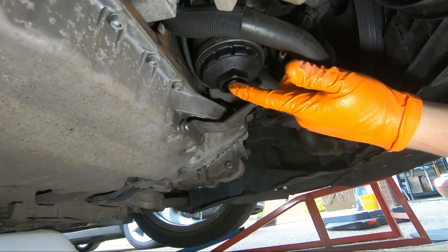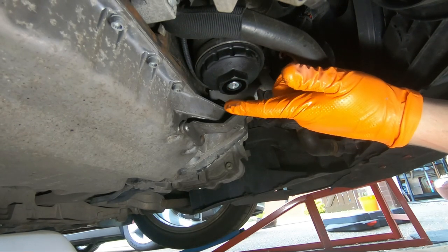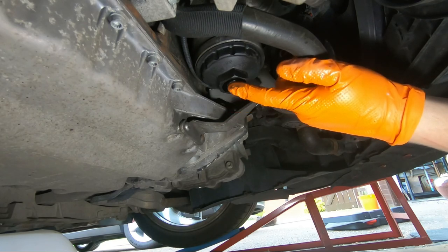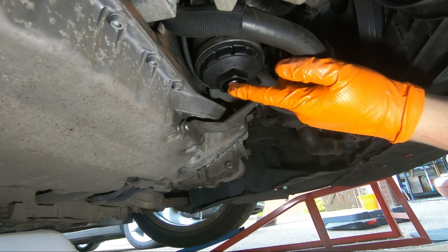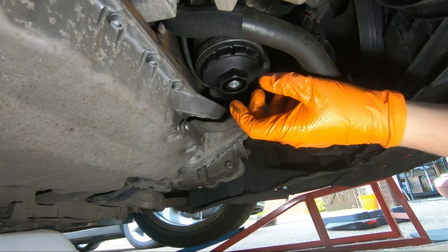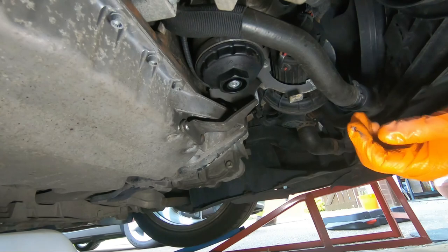However, that bolt commonly rounds off, and it commonly is over tightened. There's an O-ring on that, so it really does not need a great deal of torque. I actually had to replace my housing due to it, because it had just mullered all the threads in it.